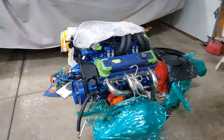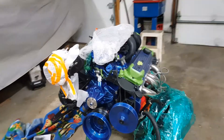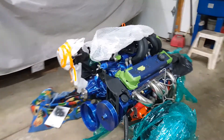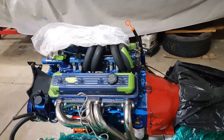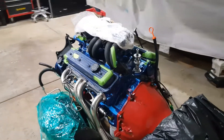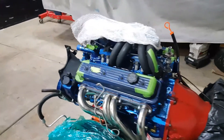Welcome back to the channel. What I'm looking at here is a 5.7 liter small block — it's a 355. I've been building it for the past couple years little by little. Today we're going to talk about spark plugs. This is an L98 block engine, original out of an '89 Iroc, and I have put Vortec heads on this, so obviously my spark plugs are going to be different.